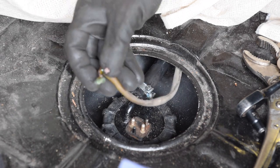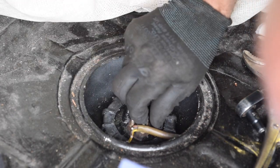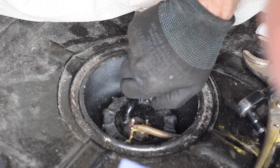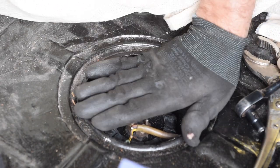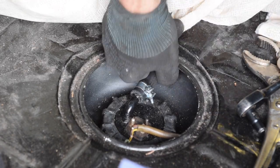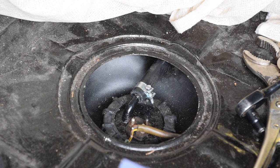That's on there pretty sweet now. What I need to solve next is the connector that goes on there — I've got all the bits over in a box somewhere so I better get those out. That's pretty good, I'm happy with that — just making sure it feels like it's on there. That's the return line completed then from the engine all the way back to the tank. We just need the 12mm pipework to go from the internal filter to the pump, which I'll get on order now.